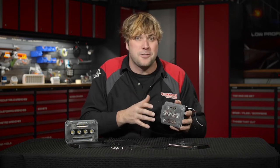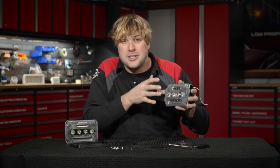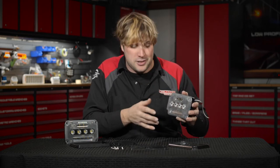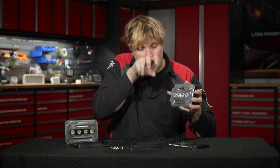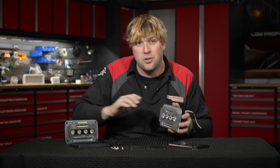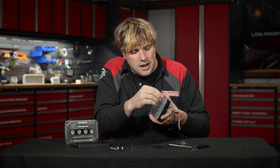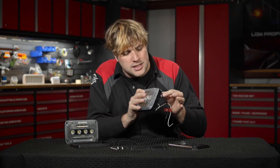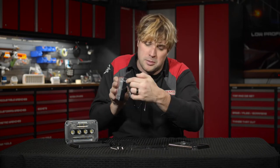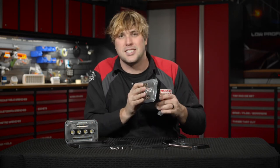It's a perfect fixture for the side of a fire truck or the back of a truck where you need a compact fixture that packs a lot of punch. It produces an asymmetric beam pattern very similar to the Firetec Guardian, where the top and bottom row shine down and the center row shines straight out. It's available in a blackout model or in the standard model, and what's really cool is that the screws never come in contact with the lens. Unlike a lot of fixtures, when installed on the truck, the screw touches the aluminum slug that then goes into a galvanic isolator, preventing cracking of the corners — which is oftentimes where water gets inside this size fixture.